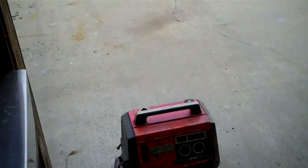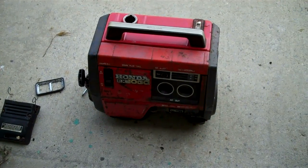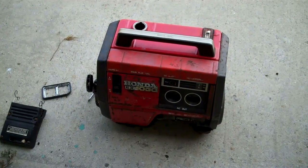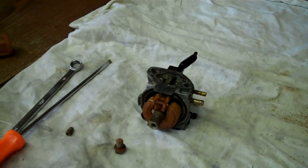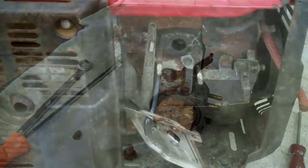And for the little generator, I have another one back there. But now these things can be found all day long, on eBay, Craigslist, that simply don't run, don't make power. Now it can be a gamble to buy them, but this one just happened to have ethanol poisoning. And basically it's just going through the whole fuel system, cleaning it out and getting some fresh gas in it. So we'll get that thing back together.